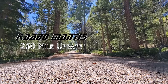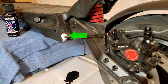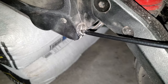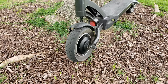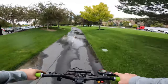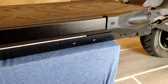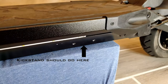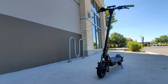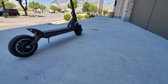I want to talk about some things I brought up in my 250-mile update video. I plugged both open ports in the deck with moldable glue for waterproofing. One thing I forgot to consider was that when the suspension compresses on the back wheel, the brake cable moves and the glue breaks loose, negating the waterproofing effect. The glue stayed mostly intact at the front port, which is where water is most likely to get in, so overall I'm glad I did it. I haven't had any water damage from the occasional puddle or sprinkler runoff. Also, the kickstand had fallen off — the holes drilled for the screws were too large. I literally doused the screws and kickstand plate in super glue and smacked it back on. It's held up great, but it's annoying to have to MacGyver something so simple.